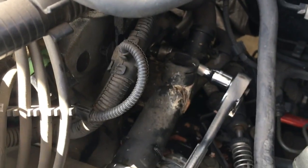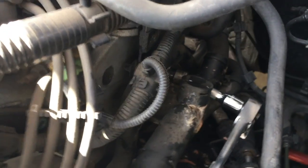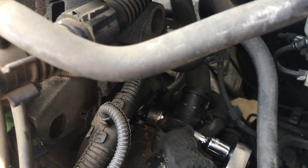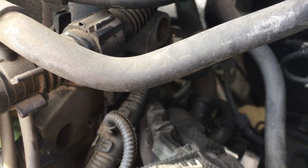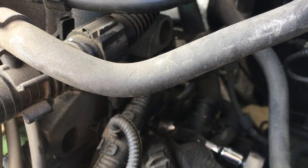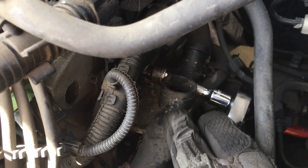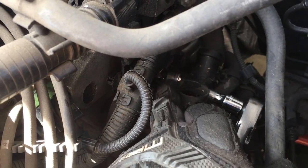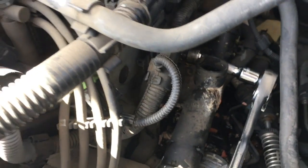I made one mistake already — basically there's a bolt that's kind of like a stud holding this bracket. There are two 10-millimeter bolts. What you have to do is take off the first one, and then for the second one, see this plastic hose — you can pull up on it to get that bracket out of the way so you can get your socket on there. Once you've got your socket on, you can let go and unscrew the bolt, and that will pull the stud out. I tried to take off the flange before doing that and broke the area around the hole, but that's okay since I'm replacing it anyway.